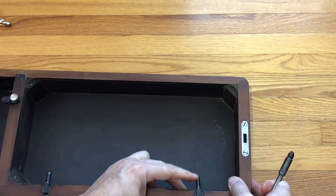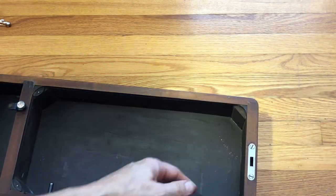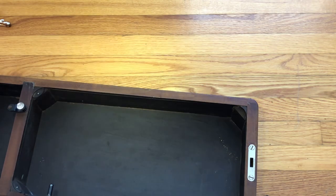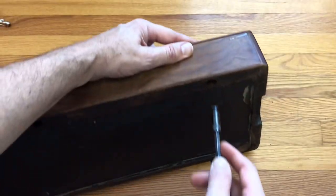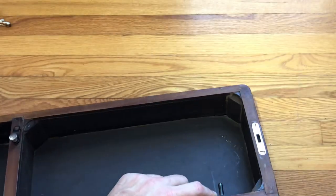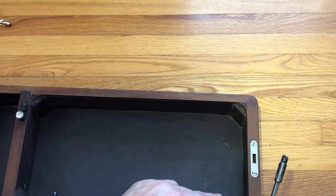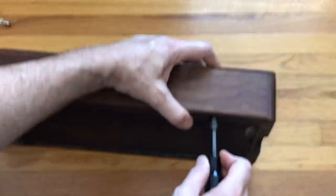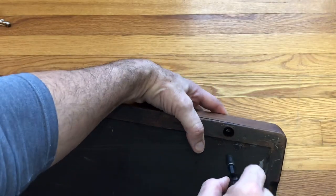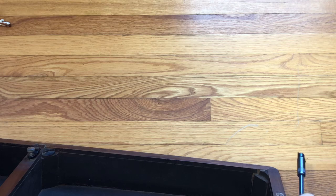I've got it snug — let's see what I have here. Uh-oh — first thing I notice is that this hinge pin is at a different angle and it's not quite as flush. So let's back off again. Be patient with yourself — if you're like me and you're doing something for the first time, it's okay if you don't get it right the first time. You want your hinge pins to be as symmetrical as possible because your machine is not going to particularly care for asymmetry.